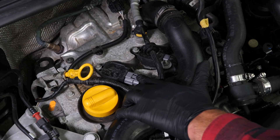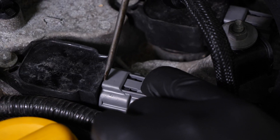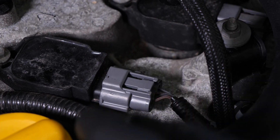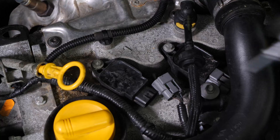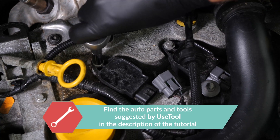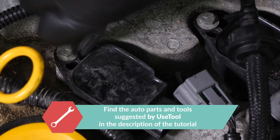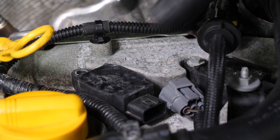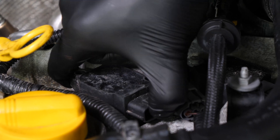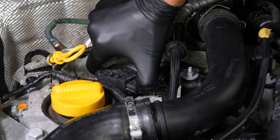Pull on the tab for the power connector to the coils, lifting it with a flathead screwdriver. Now remove the tab. Using a socket wrench and an 8mm socket, unscrew the lock nut located on the coil. You can now carefully remove the coil, making small lateral back and forward movements.